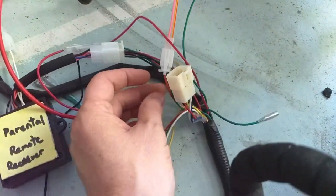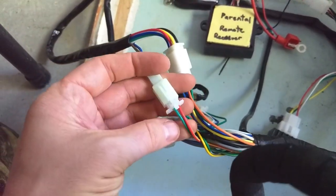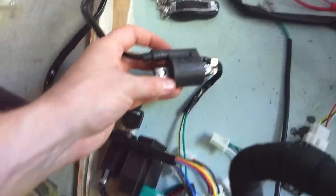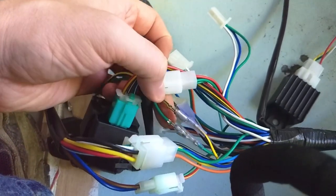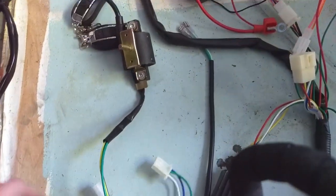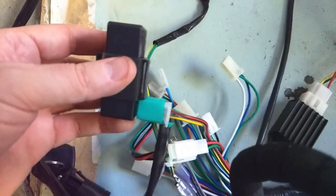You've got the pink and then the yellow wire that will be connecting in to the red and the green. The red with yellow stripe and the green wire go through the harness and then they'll be coming up here to the front red and green, and that goes into the blue and the brown which comes up to what should be the starter button on the inside. So now that we're on the front you have your ignition coil. The ignition coil should just be coming through with a yellow wire and a green wire loose with bullet terminals.